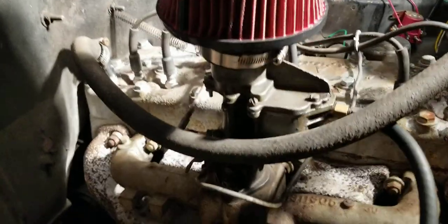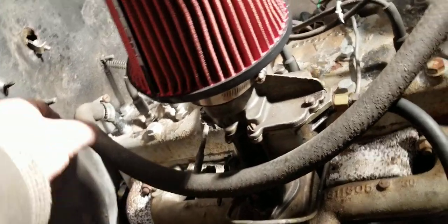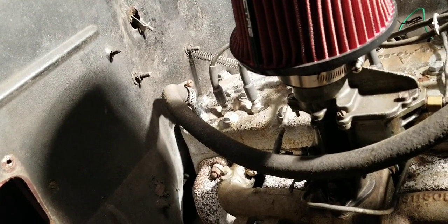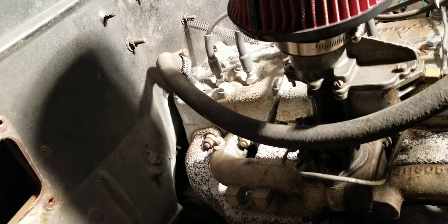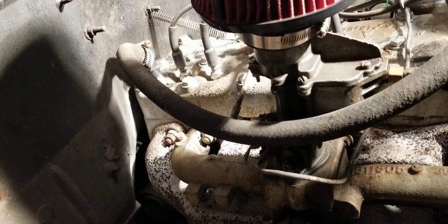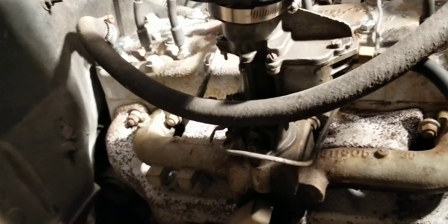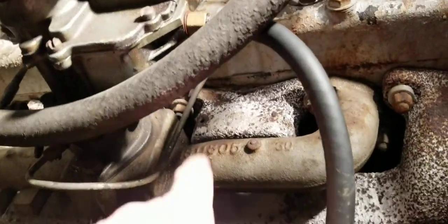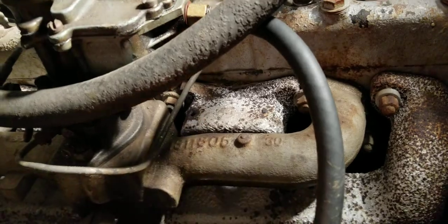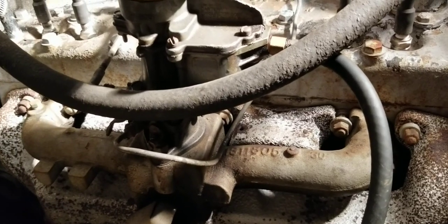There's no way to control the choke, which is no big deal. I'll just run a cable — it'll hook on the other side of the carburetor on that linkage, and then you just pull it to close the choke, push it in to open it all the way when the vehicle's warmed up. One concern I have is there's a little hole here that poked through — I'll have to see about getting that welded or just use some JB Weld with a tapping screw. I'm getting a little exhaust pop there.